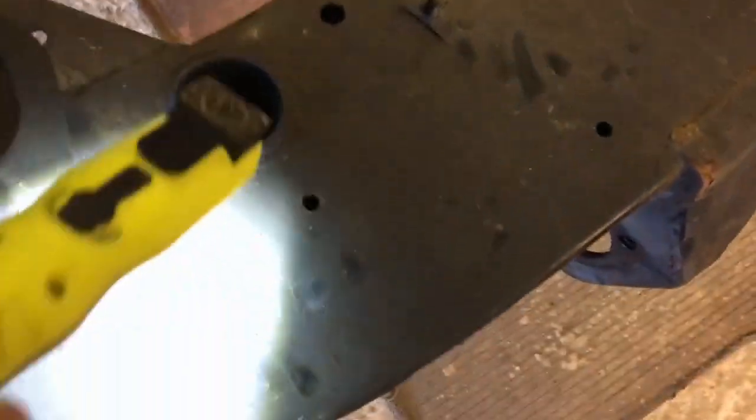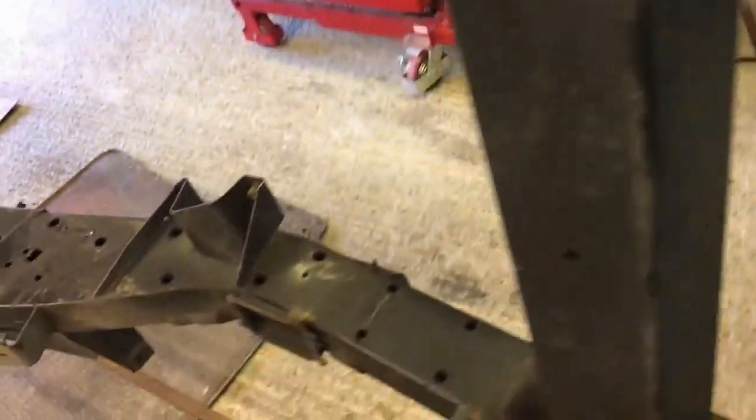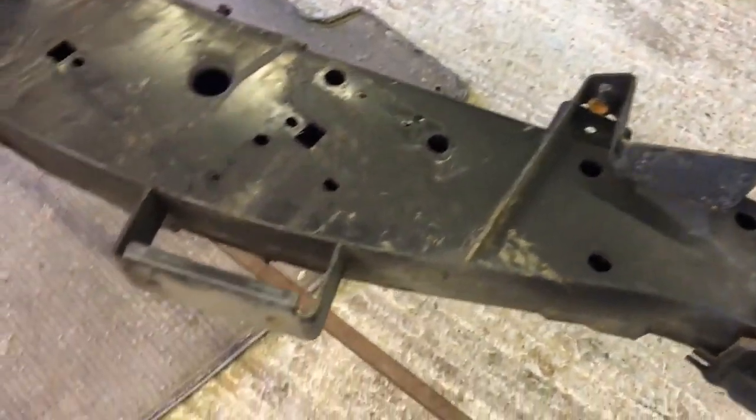I did actually wax all down inside these tubes as well and everything. Maybe we can see something down in here. Yep, you can see in there. There we go. So it's all clean inside there. So wax oil does do the job, and when people tell you it needs to be redone every year or so, I don't believe them. As long as it's on the inside and it's not getting washed out by constant swamping or whatever, I think it should all be fine.